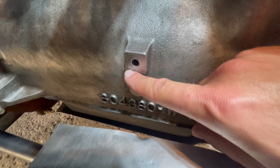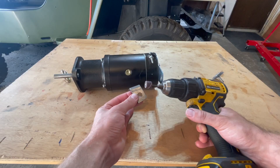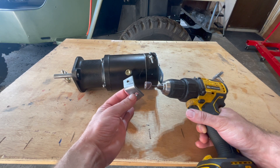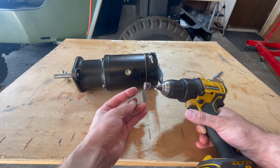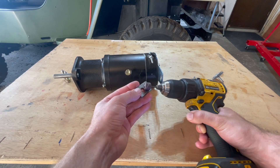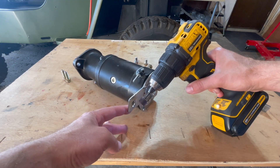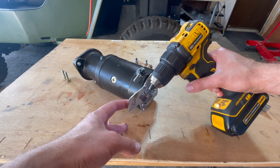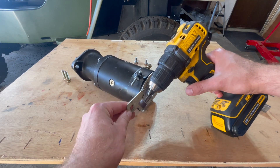Make sure there is no paint on your engine block where your bracket will meet. In addition, remove all the paint from your starter motor-to-engine block bracket using your sanding bit, and remove all the paint from the bracket on your starter motor on both sides, to ensure we have a good ground on your starter motor.